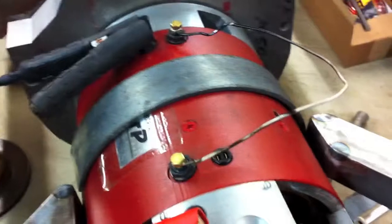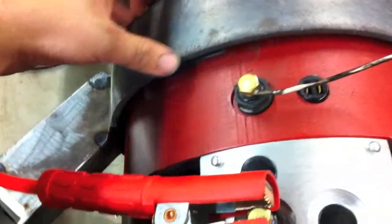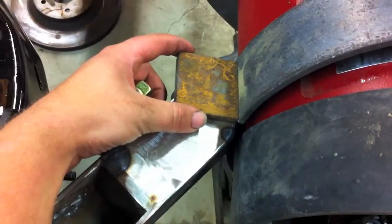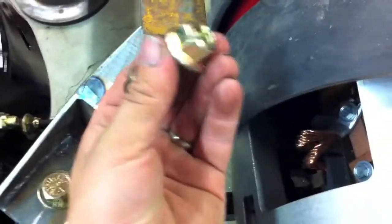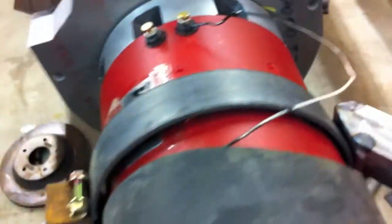So now the next step — some night this week, getting light tonight — I'll get this plate in position here, and that's gonna go basically like that on top of those on each side. And what I'm gonna do is I've got some little plates here. We'll weld little brackets onto there, and they'll be at the same angle as this. And then we've got these grade eight half-inch bolts that'll drop down through there like that, with jammed flange nuts that'll get welded in on the bottom of the arms. So you just tighten it all down — it'll pull the bottom up, clamping it all in the ring. And then you've got two half-inch bolts there that'll drop into the mounting points of the motor, locking it in.